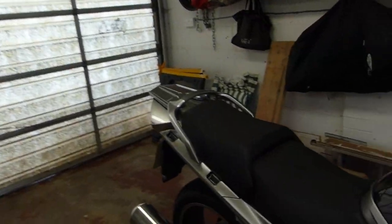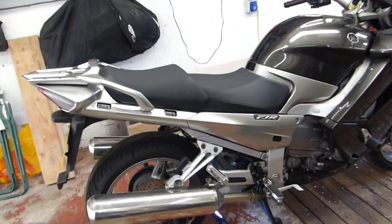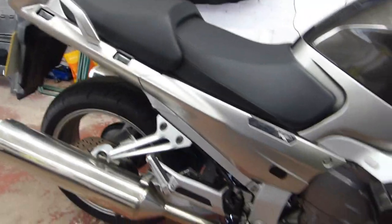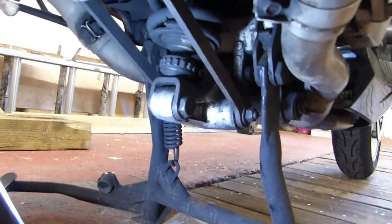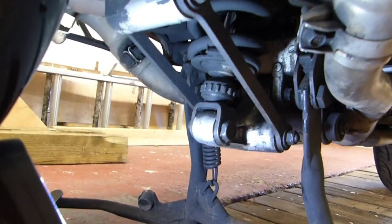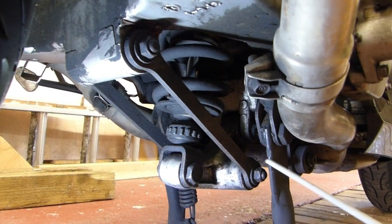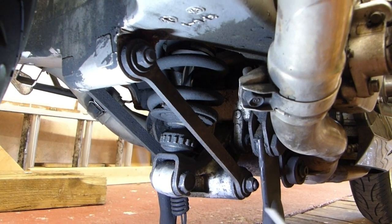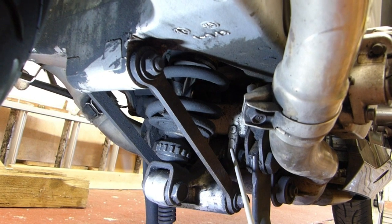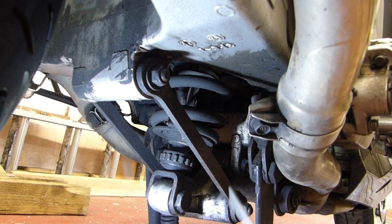Let's have a little look at the problem. The big issue with this is going to be access. If we come down here and look at the suspension components, we can immediately see there are a number of issues. What we have to look at for the overhaul are the bearings here — the main one at the bottom of the shock — the two bearings here and here that connect the dog bones, and the one that causes all the problems in terms of access: the bearing that sits in the rocker arm between the two lugs that are mounted to the frame.